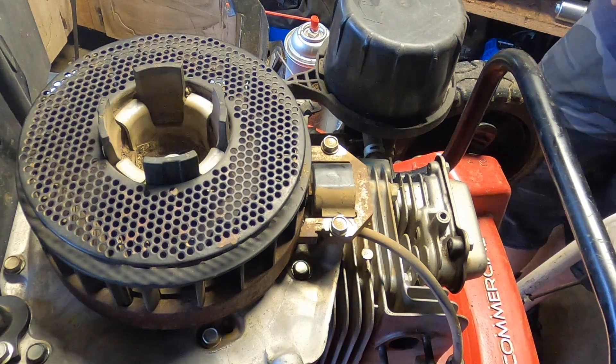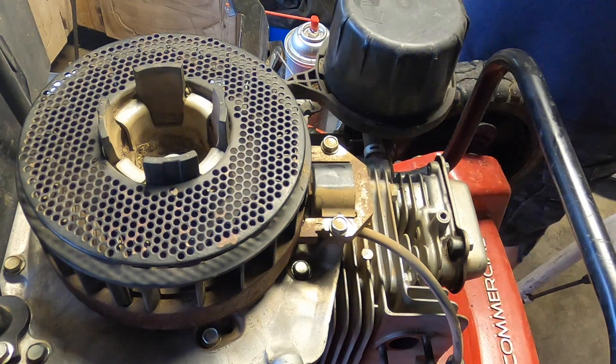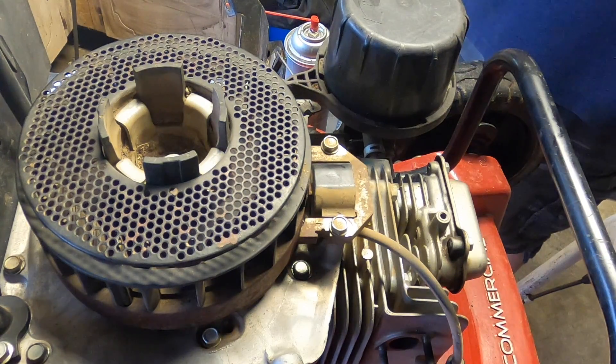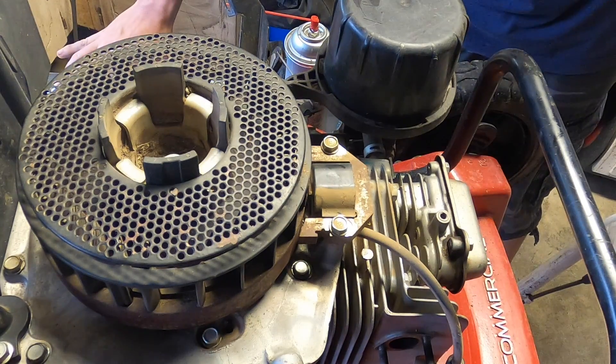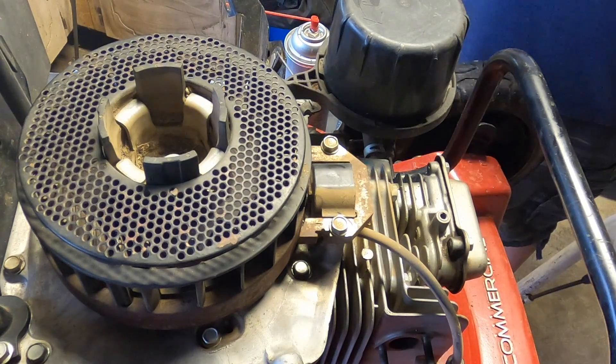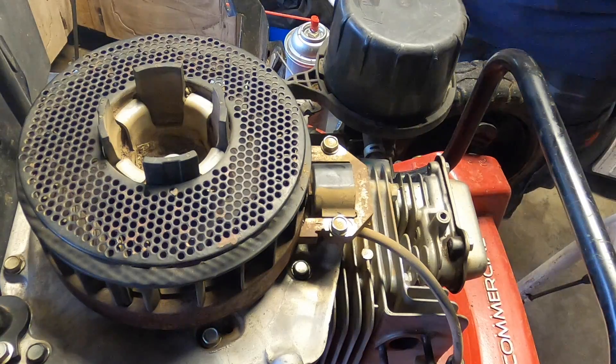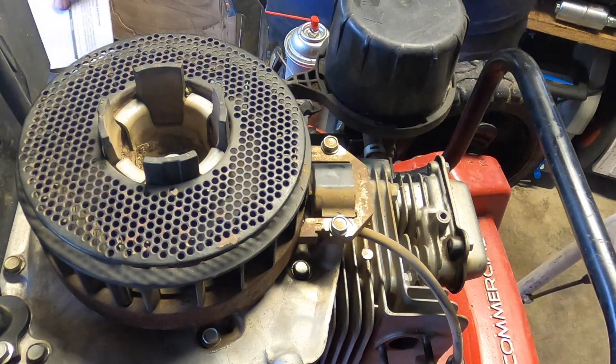Now the difficult part is, for this one for instance, it's ten thousandths of an inch. Some people like to go loose and easy and say a business card. I'm going to go loose and easy as well and say this is three pieces of paper folded in half. According to my meter, this is ten thousandths of an inch. If I really squeeze on it, I can get it down to nine thousandths, but that's really splitting hairs on that one.